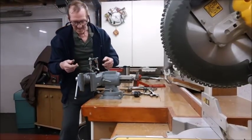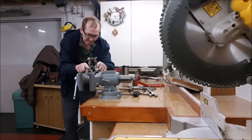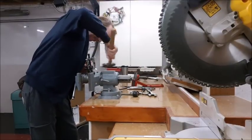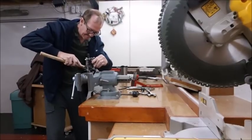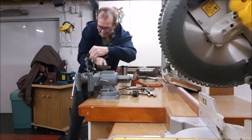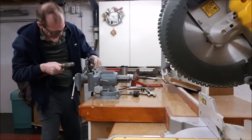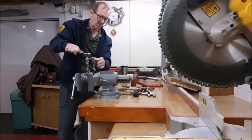What I've done is I've basically had to malform the fan blade so that I can get this puller in. There isn't any other way — it's got to be with the puller. I can't quite get in there otherwise, so I'll just have to straighten up the blade when I've finished. Hopefully.